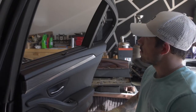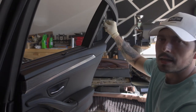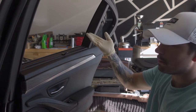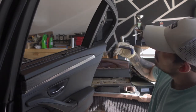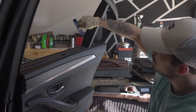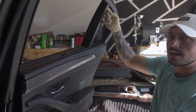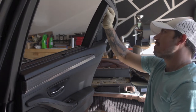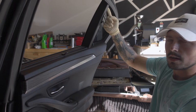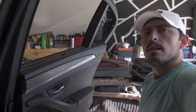The first thing you want to do when taking off your rear door panel on your F10 is remove this little sunshade mechanism for the side window, because otherwise it's in the way and prevents you from pulling your door panel up and off the door. It's only held on by some tabs that snap into a groove on the back side. You pry them off from this side and then pull the assembly off - be really careful because there's a thin piece of plastic where the cutout is for the shade, and if you don't do it right you can snap that plastic.